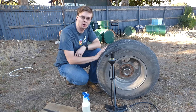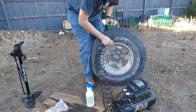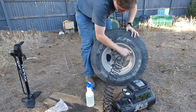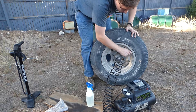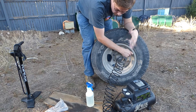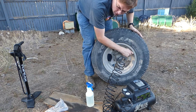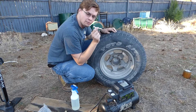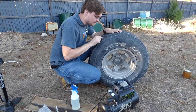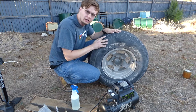Got the puncture located using the soap and water method. I've got this guy pressurized. We're going to fill up the tire with air. This doesn't need to be the full PSI that the tire requires. I just need to get it high enough that it's outputting or pushing out air through the puncture, wherever that is. I've got the tire up to about 15 PSI or so, which is plenty enough because I can hear something hissing in this general area. I'll take you guys in for a close-up and we'll see exactly where it's coming out.